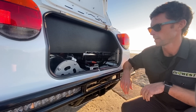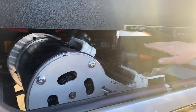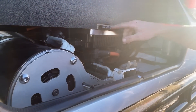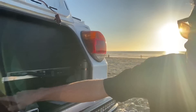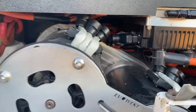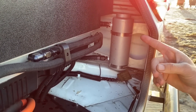In the engine compartment we have dual AC34 motors from HPEVS, operated by Curtis 1238 controllers. There are two of them, and both have a liquid-cooling chill plate that we manufacture to ensure the controller never exceeds a dangerous temperature. You'll also see EV West's billet adapter plate to run a Type 1 Volkswagen transmission with this dual motor setup. Back here you also have four Smart modules as part of the battery pack, plus a coolant tank for our glycol cooling system.